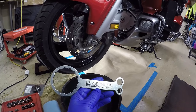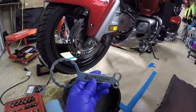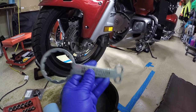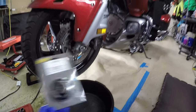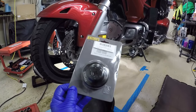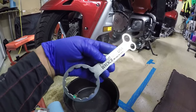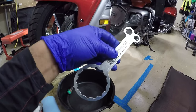Also, to get off the oil filter, I'm going to be using this 3-in-1 smart wrench that I picked up. I will include a link in the description of the video of where you guys can pick up one of these smart wrenches. It has the ability to take off the oil drain plug too. So this one wrench could take off the filter and the plug. Or you can just use an oil filter wrench cap or oil filter wrench cup. This works really well on certain filters because the 3-in-1 is not going to work on all oil filters. Some oil filters are smooth, and this is not going to work on the smooth oil filters. It only works on the oil filters that have the grooves, like the Honda OEM oil filter.